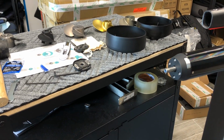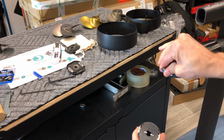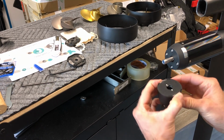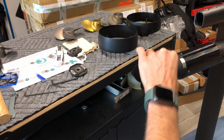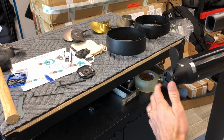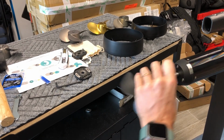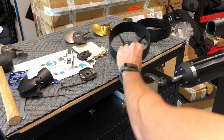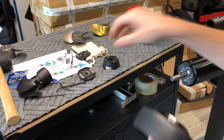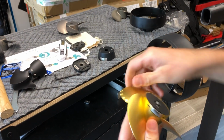So when I recorded this, this is the first time I put the folding prop on here. And I thought you had to kind of line it up. You don't actually have to line it up. You can just kind of slip it on there. You don't even have to press the 2 indents on the side. You can just slip it on there and then turn the folding prop, and those little 2 little pins will slide right into the shaft pin slot on there, and it'll line up. You got to make sure it clicks though, so it's locked, and it's really easy to kind of switch on and off. So that's cool. And now the install is pretty much done.